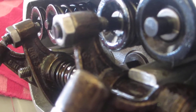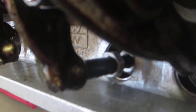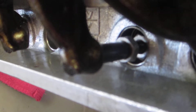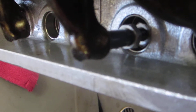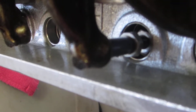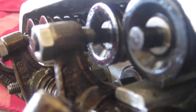I'm going to run with that. It's at something like 8.8 inches, and again this is with the two-piece lifters, so bear that in mind when setting up your own rocker geometry. If you're still using the one-piece lifter push rod, you'll need a different push rod measuring tool and all your specs will be different — but you'll still want to get the valve screw and the head of the valve in line at exactly half lift.